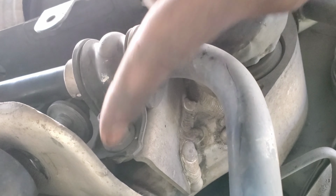It's just not cooperating. I got the traction arm connected to the silver stud in the back. I had to hammer it off. And then on the inside, I've got the forks here. But the forks can't slide down and they can't slide up. So I'm going to have to pull this whole thing forward and then out, but it's giving me a hard time. I thought the front camber arms were going to be harder, but these traction arms are giving me a hard time.